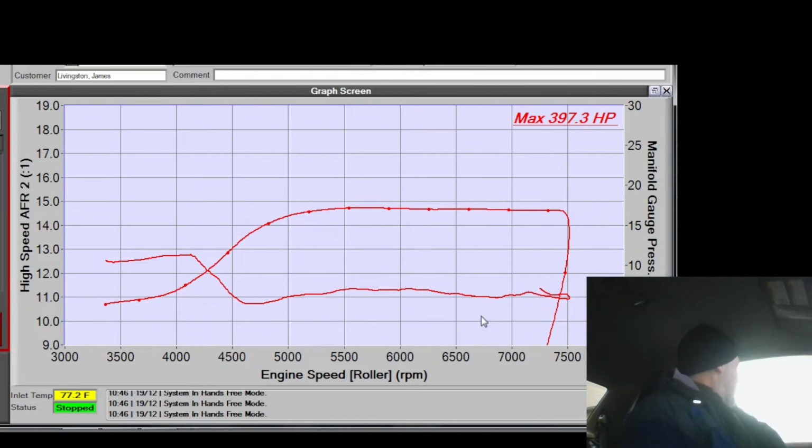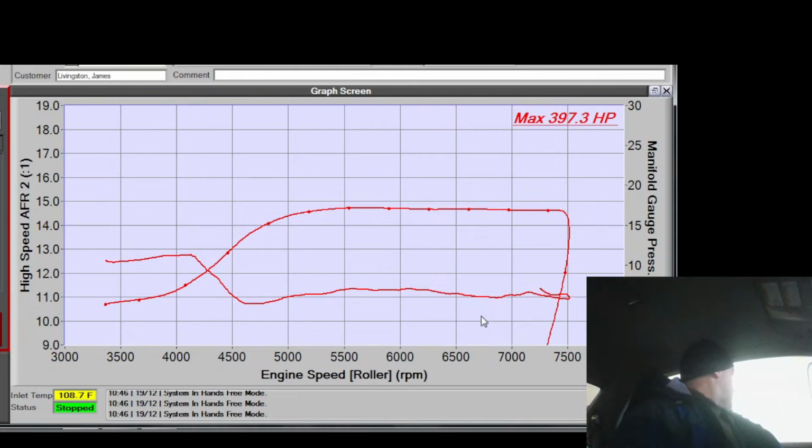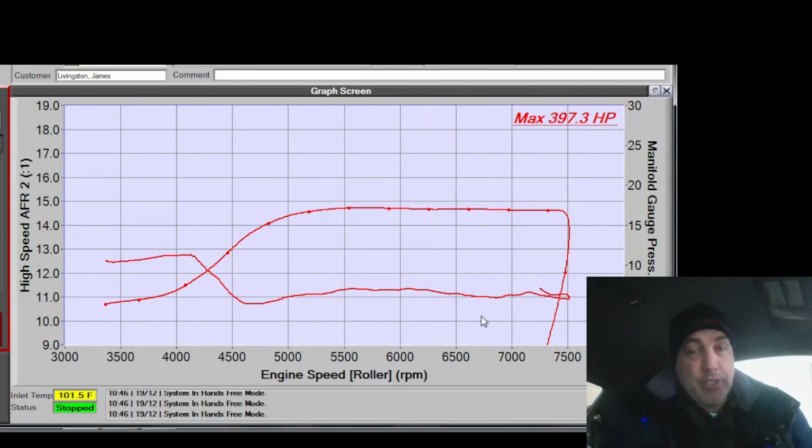Maybe? Nah, I'm not gonna put timing in it. I'm gonna say a little more boost. Leave the timing alone. It's good conservative. I like it because this thing's made for flex anyways, I think. Or not flex, ethanol map. I have to do an ethanol map on it. So we'll do an ethanol map, and yeah, I think that'll be good. So 55, 65, centered around 6. Okay, I'll do 1% there. I'm going to do 1% here. Like that. I think that'll do it. That will be good. Okay, save that because the software's going to crash again at some point.